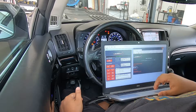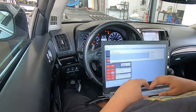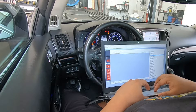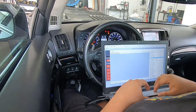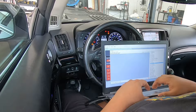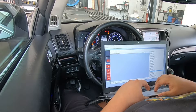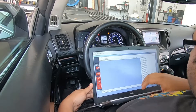Now that we have that part done, I want to log a little bit. Under Logging and Tracing, I want to do AF correction and widebands for both banks. So here I'm preparing for my base run. The hardware changes were a cold air intake and I think a cat-delete exhaust, but still stock headers. I'm logging wideband AFR, long-term fuel trims, knock, timing — the usuals. I'm going to start the vehicle and make sure everything is recording.